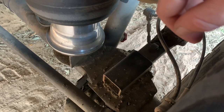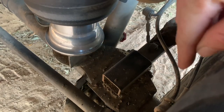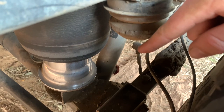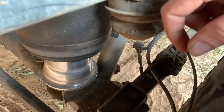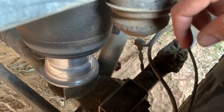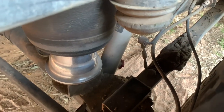The brake lines, I've done the same thing for the front. I've got braided stainless steel line 2 inches longer. The difference in the height sensor is that it's not as much extra length in it. Now, I'll have to put these numbers up. I might even overlay the top of this video with the amount that I've increased the height sensor in the front. But I'm going to need to show you this, I think. Let's go around and have a look.